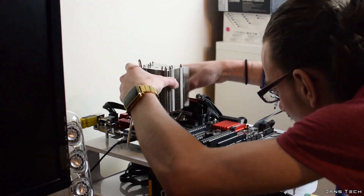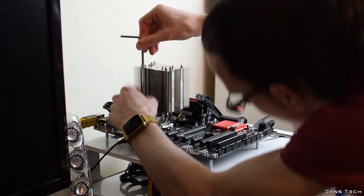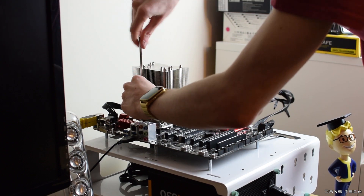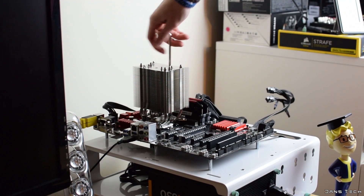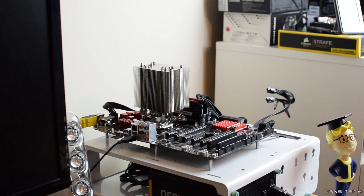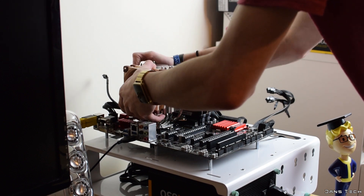Next, you'll want to add a small amount of thermal paste to the CPU. The last step for installation is to grab the included screwdriver and screw down the two large screws that are fixed with the cooler onto the mounting apparatus you've just set up on your motherboard. Be sure to screw down the screws evenly and not too tight — there's no need to break a sweat installing a CPU cooler. As for mounting the fan, this simply clips on to the cooler. Once you've installed the fan, be sure to connect it to a 4-pin header on your motherboard.